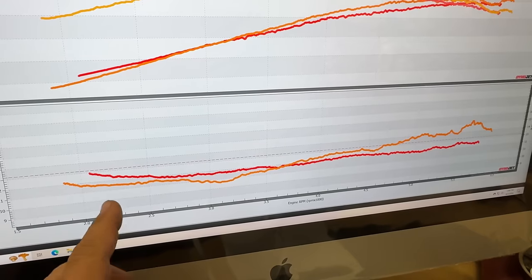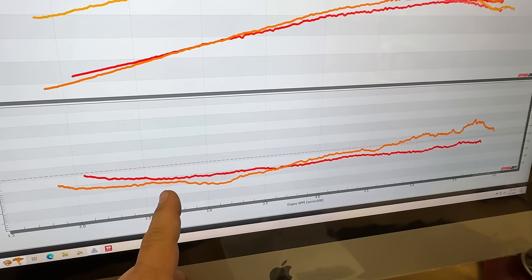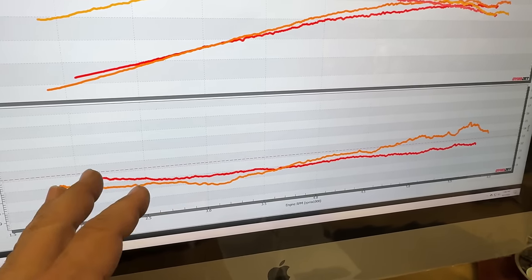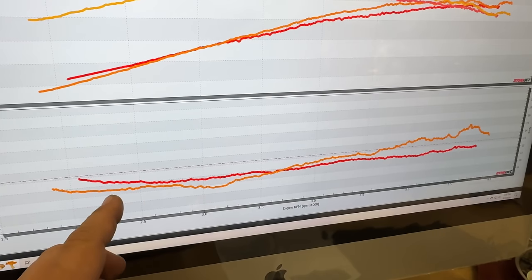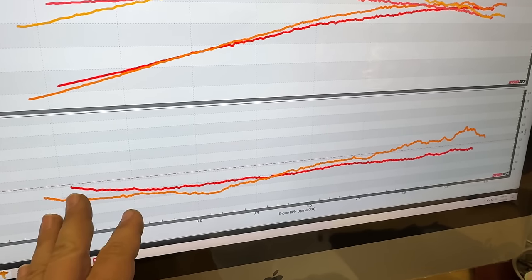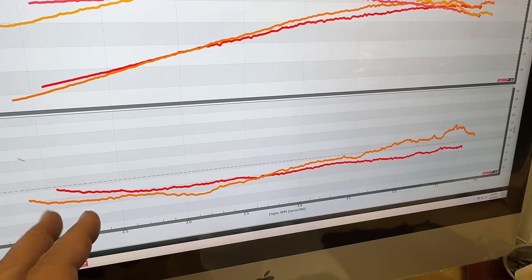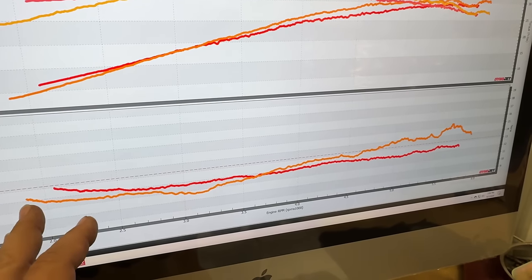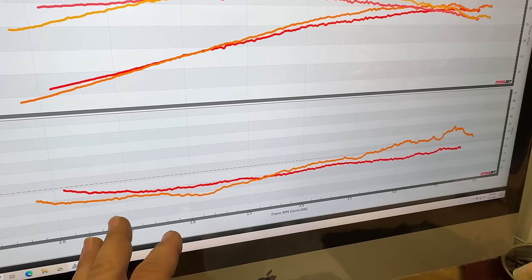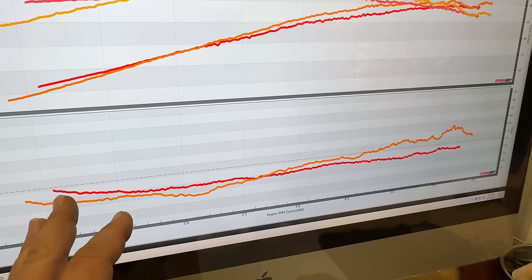I should mention, even though these two lines on air-fuel ratio are close to each other, the results are completely different. On the SU HS2s, I could not lean these carbs out any more than they are, so it is what it is. But on these H4s, we're running extremely lean at idle, and then while driving, we are extremely rich. And I think that's a good indication that those carbs are way too big.